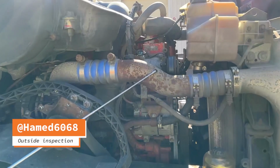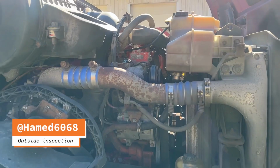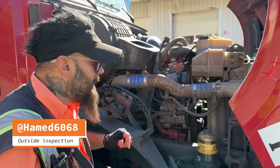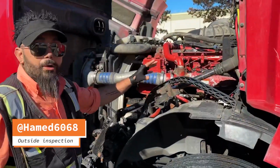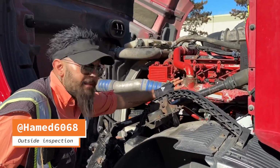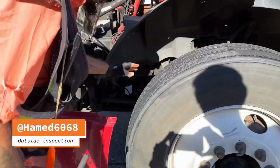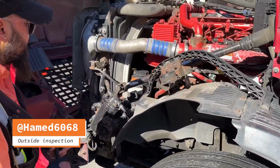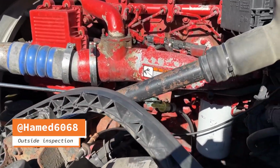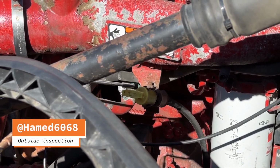Engine hoses and fittings are securely mounted, not damaged, cracked, worn, or leaking. No dripping fluids around and under the engine and transmission. I check the oil level by the oil dipstick. It's SOLA, safe operation level, above refill mark.